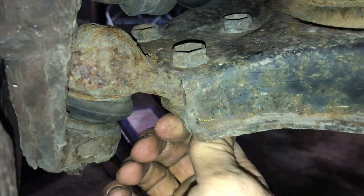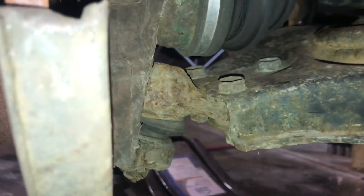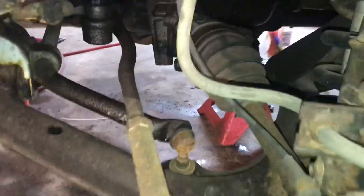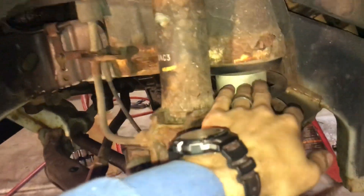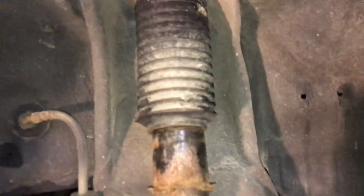The Geo has engineered this thing really well — there are just three bolts here with the nuts on the bottom. The bolts are kind of hard to press back up, but where the ball joint attaches just slides right into the frame. Break these three nuts loose, pop those bolts out, and the whole assembly slides right out. Then disconnect the sway bar, push down on the a-arm, pop the spacer in under the coil spring, and pop the spacer in under the strut.